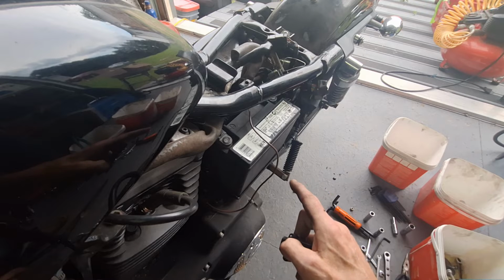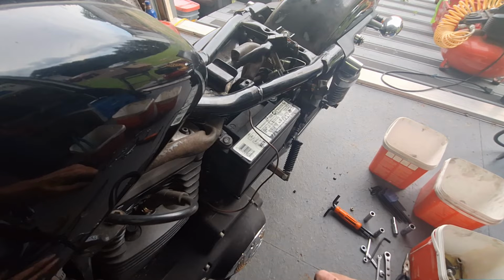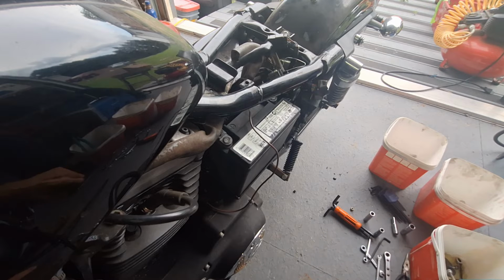The one that was in here, because it's intermittent, it actually read good, and then bad, and then good, and then bad. It's like you had to reset it. You turn the bike on sometimes, and you go to start it, and it wouldn't have any spark. It would just sit there and crank and crank and crank, nothing going on. You'd turn the key off, turn it back on, wait long enough to pull the plug and see if it's getting any spark, and you turn it back on and it fires right up.